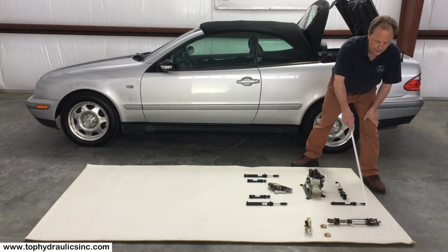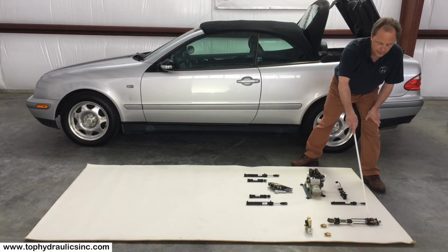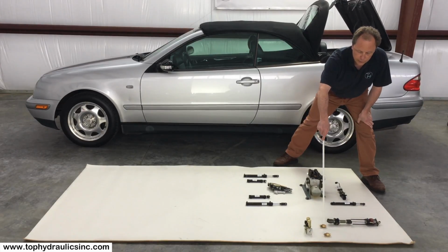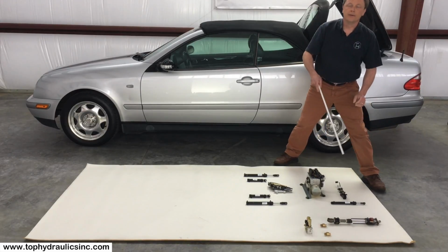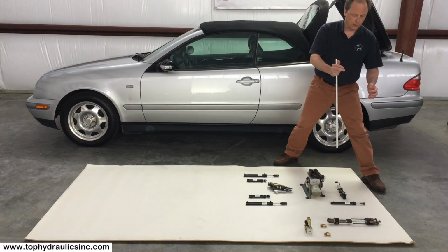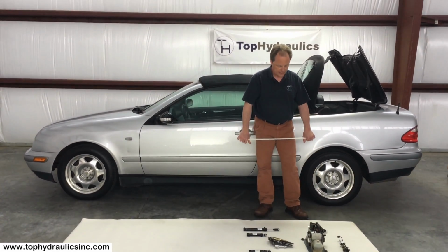But normally you can raise and lower the roll bar slowly with the roll bar button in your console, and that is done through this roll bar lift cylinder, and this cylinder is controlled through the rollover bar valve block. There's also 2 so-called lock pawl cylinders that lock and unlock the holding mechanism for the rollover bar system, so it stays either extended or lowered. So let's go back to the main convertible top system, because that typically is the first thing to fail.